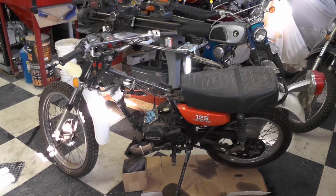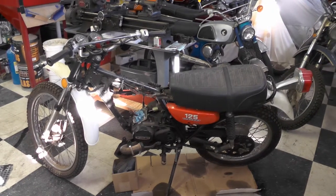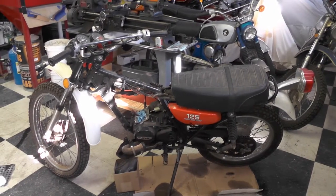I had to get the motor freed up. The reason the motor was stuck is simply that the rings were rusted to the cylinder bore — took a little persuasion, a little heat, a little lubricant to get it free. What it really needs is just a set of rings. I miked the bore and it's well within stock specifications. With only 2200 miles on it, that's what I'd expect. I'll replace the rings, clean up the piston, install a new wrist pin bearing, and clean it up in general.